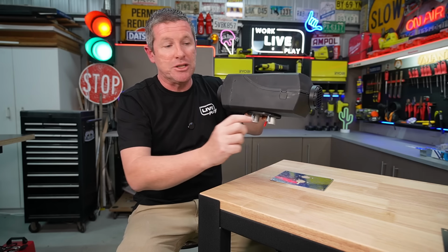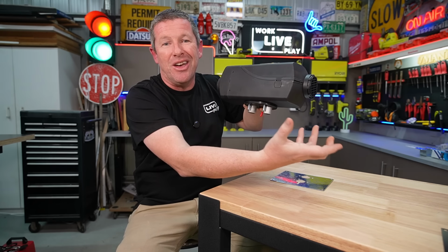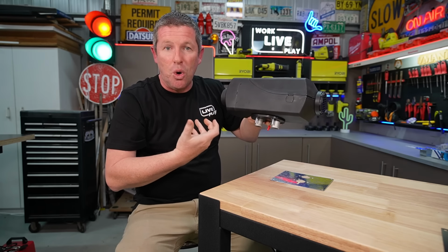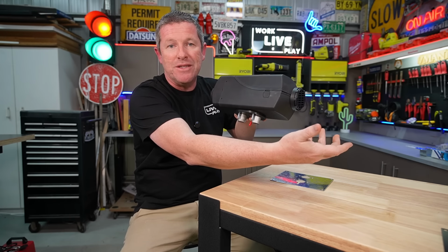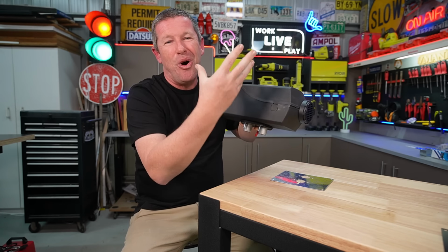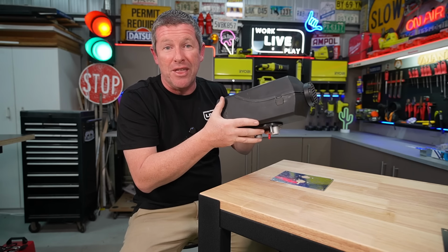Now, what some people like to do is you'll have this other duct coming out that will have your little silencer or filter on it for the combustion air that comes in. Now, you don't want that facing forward necessarily because that will get caked with mud and dirt. You want it hanging backwards if you can. So in our case, that works really well. That hangs out towards the back of the Caravan, and it means it's not going to get all gunked up and dirty so much, even though it's on the underside of the Caravan.